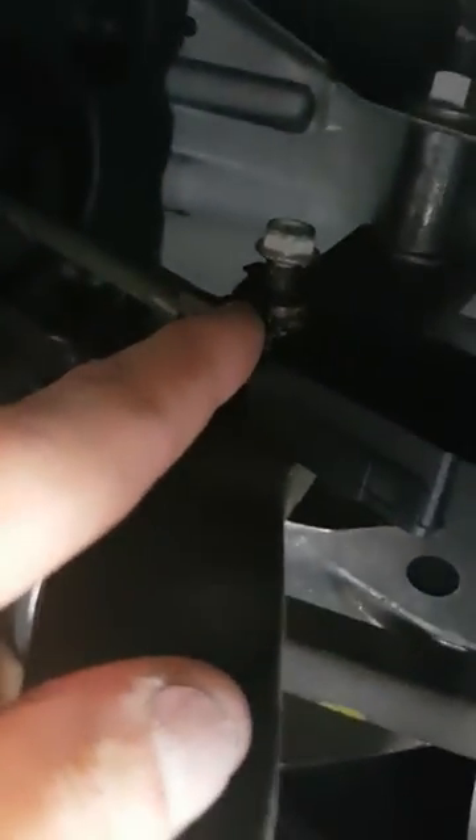It's super easy to replace — it's right there right under the brake pedal, and I replaced it in about 5 minutes. You take this bolt out, and then there's a little clip there you take out with a flat head screwdriver. Then you take out this little electronic clip and just switch it out, and my cruise control works perfectly.